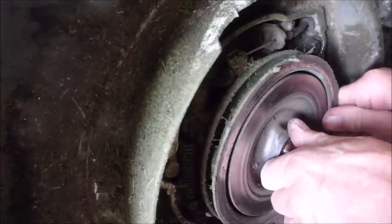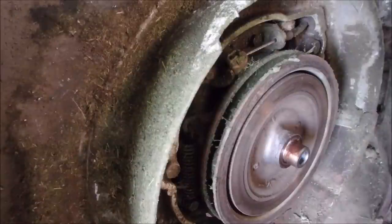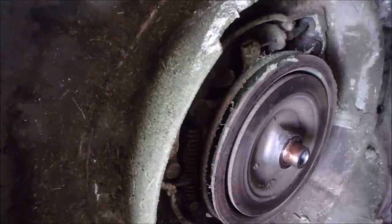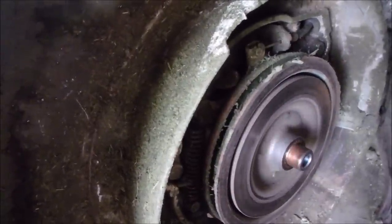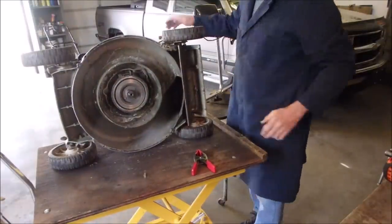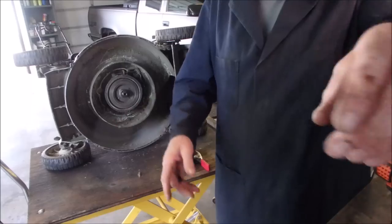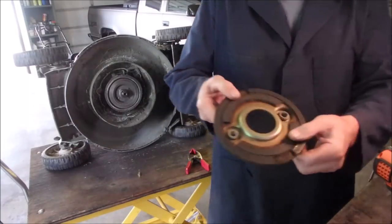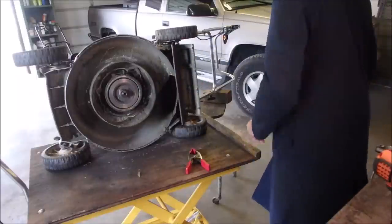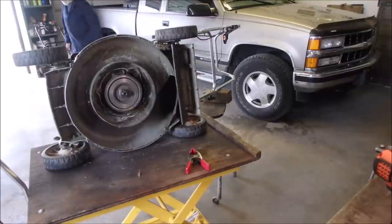So now that should be locked. When it's engaged, I should be able to turn the motor from that assembly. And yes, the spark plug is disconnected. There we go - isn't that a beautiful thing? How many of you guys are waiting for me to crash a lawnmower online? So now, brake fluid cleaner - I'm just going to clean this face, not this one but this one, and the face of this clutch, and we'll see if we got lift out. And if that's the case, we'll put it back together. Non-chlorinated brake cleaner.